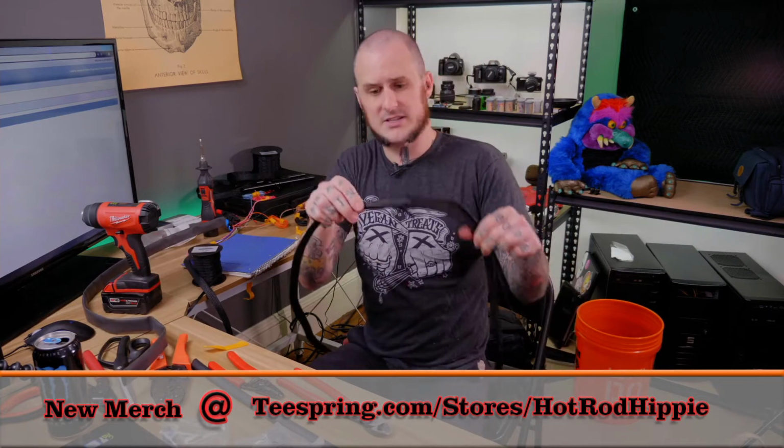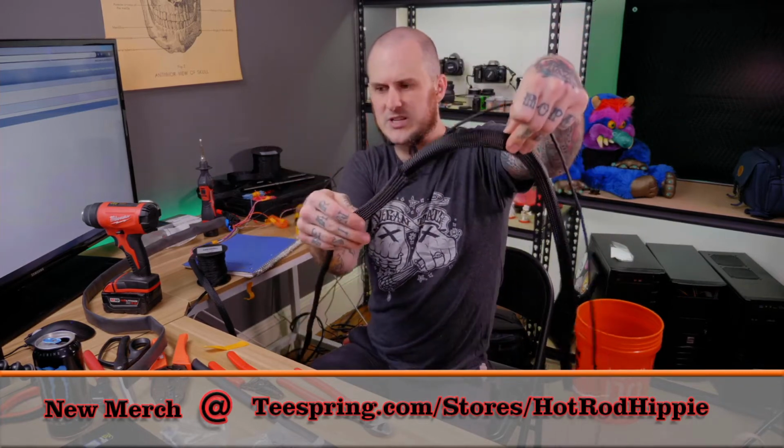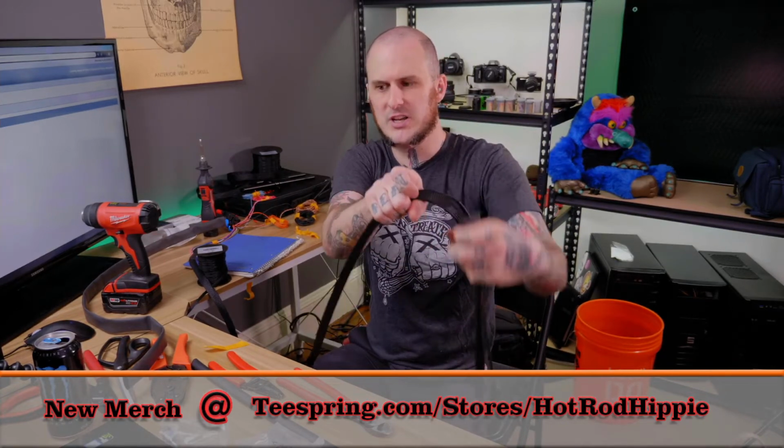All right, now I've got this harness. I've got the main harness going back to the TCM connector, sleeved over where these two split, and they're slipped inside of there. So now I need to slip heat shrink tubing over this to seal up this junction and make it a cleaner overall finish.